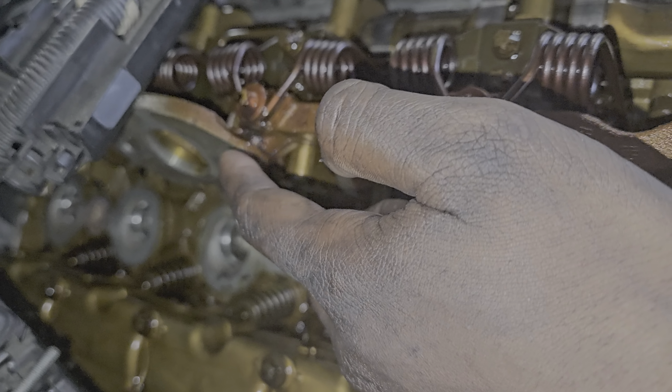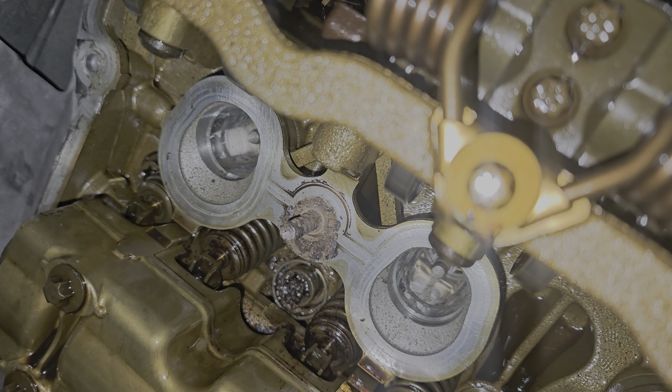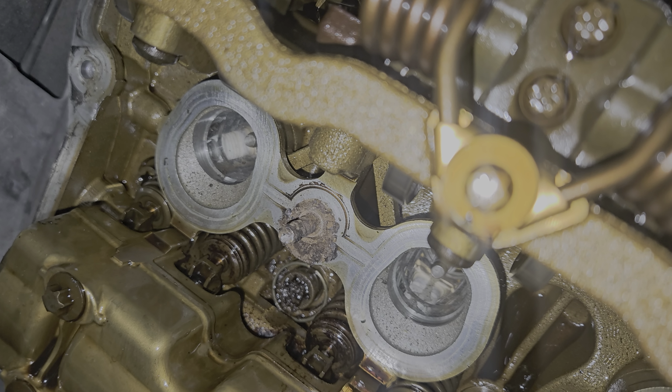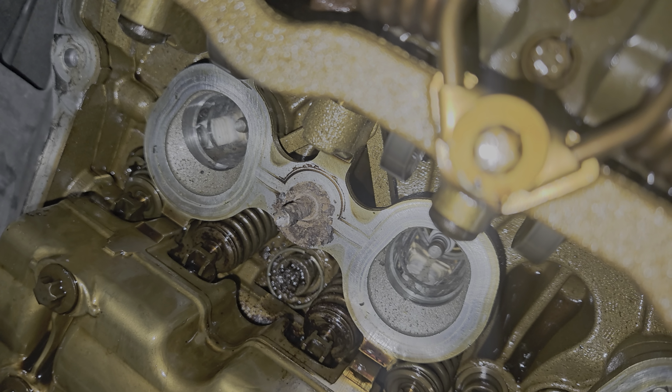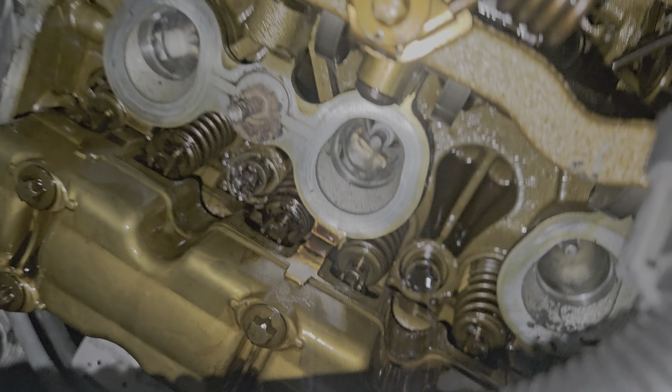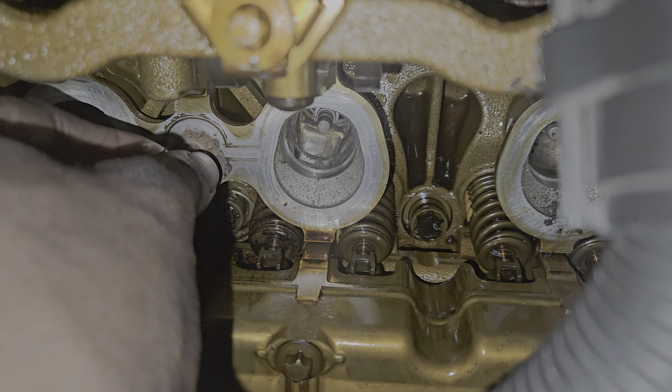We are replacing this gasket as well. One of these bolts did snap off inside, so we do have to end up figuring out a way to get this out, likely with a stud extractor. We'll also clean up some of that debris you see down there inside the engine. There's a lot of dirt and everything around here, so I'm going to go ahead and get all of that cleaned up. But we do need to go ahead and get this stud out of the engine